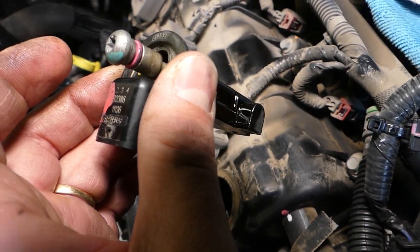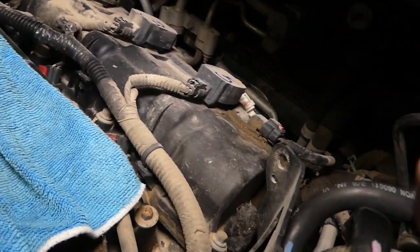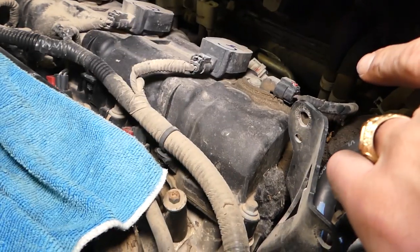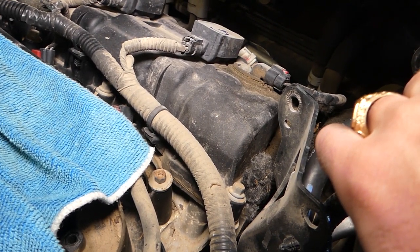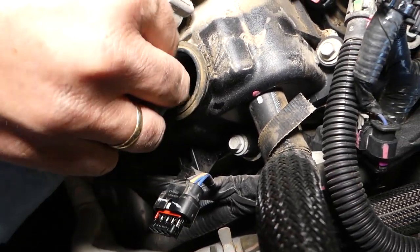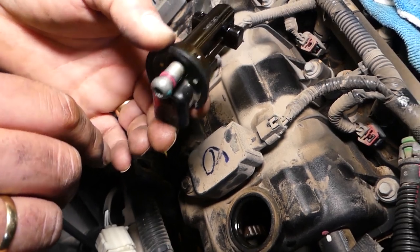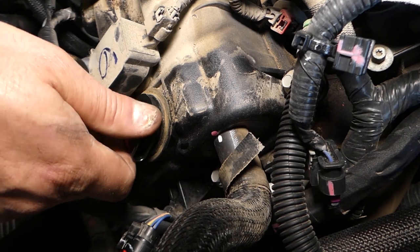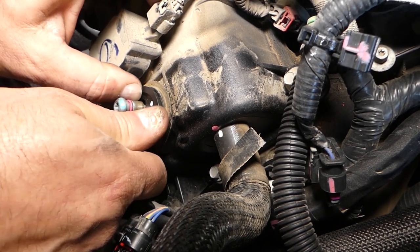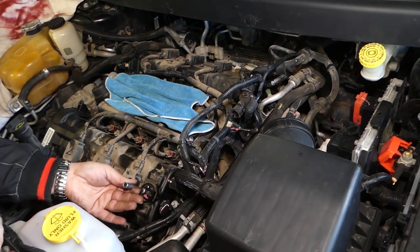All parts and tools including replacement sensors are listed in the description below. The rear sensor procedure is exactly the same — disconnect the wire, remove the bolt, and pull it out. I recommend replacing the seals as well; old ones will start leaking. The one on the back is developing a little leak — otherwise you'll start smelling burning oil. Installation goes in at an angle then straight, push it in, get it tight, and don't forget the cable. From that point, put everything back together in reverse order.